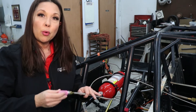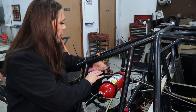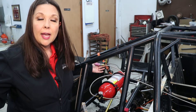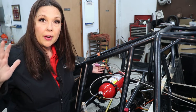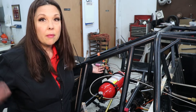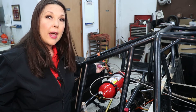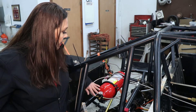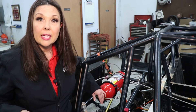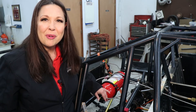This first line — the shorter line, about two feet or so — we're going to point towards the fuel cell, because that is one of the biggest dangers. If you end up upside down and your fuel starts on fire, that's a very critical situation. And since these cars don't have rear view mirrors, you don't even know what's happening, so you can't pull off the system yourself. We're going to mount this to the top of the interior. The other line coming from this side goes towards the front and will end up in the cockpit. This is part one of the installation.